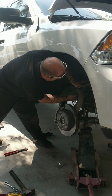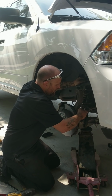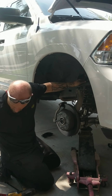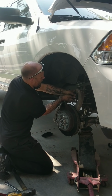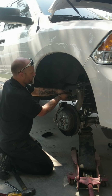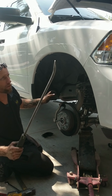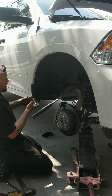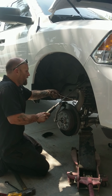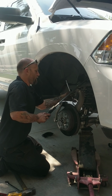Start the bolt there. Go ahead and put your tie rod end in there, the proper nut there. I have to go ahead and get my upper ball joint tight. What could happen is right here the ball joint could spin, so you gotta watch that. A little trick if that does happen, you take a pry bar, press down on the control arm and not drop your tools, so then they'll roll down the driveway. Go ahead and hold it down, that way it don't spin on you.